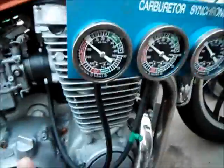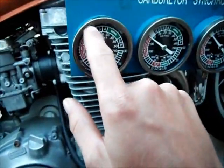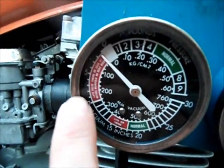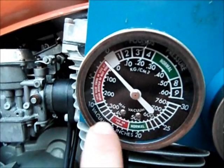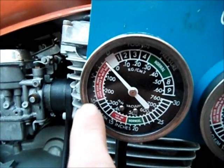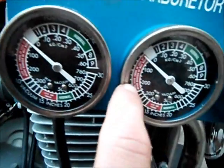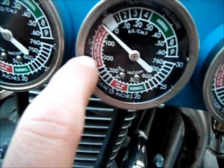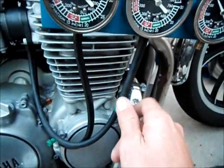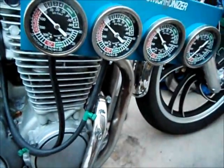As you could tell, the needles were going right about on the outside of this gauge. You can go off either set of numbers, but I usually go by this scale because it's easier — I've got 8 here and 8 on this gauge right here. That's what you want your needles to do. What I was doing was just adjusting this needle in and out until I got my needles to a steady position.